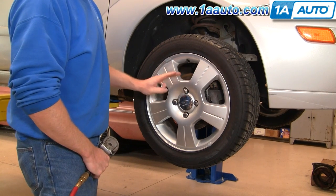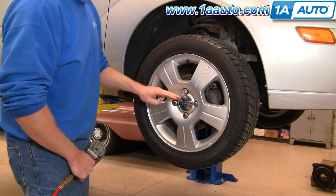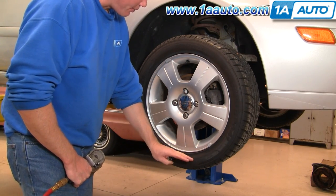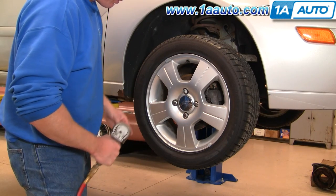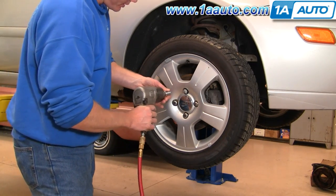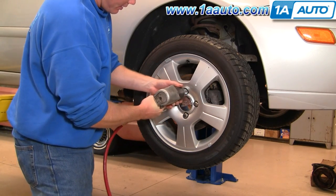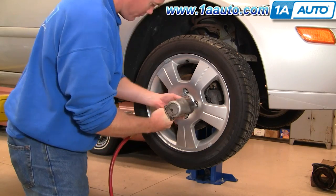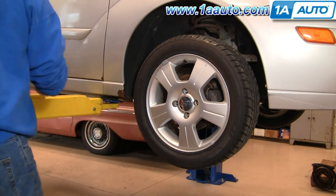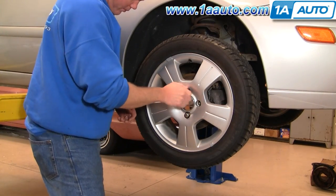To remove the wheel and tire, you can use your lug wrench that comes with the vehicle. If you're using hand tools, you want to have the tire on the ground — loosen the lug nuts first, then raise and support the car and remove the lug nuts. You will need a thin-walled socket, as regular impact sockets don't really fit in here. I realize the wheel is stuck on, so I thread two lug nuts back on and use an alternative method to remove the wheel.